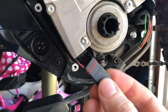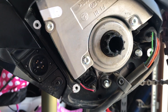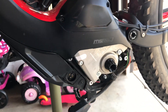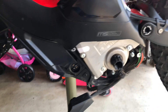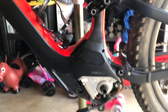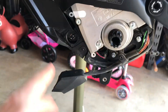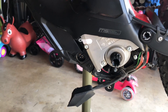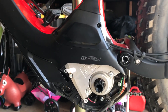It's really that simple, and the new switch has the same pin configuration. However, this won't work by itself when you just plug the new switch in — the new bikes have new firmware which accepts the programming changes. So take the bike to your dealership; Specialized has to hook into the bike, connecting to both the motor and the battery controls at the same time, and do a 2018 firmware upgrade.